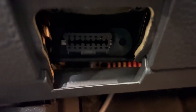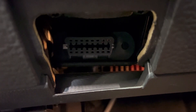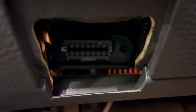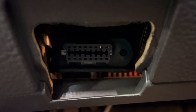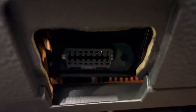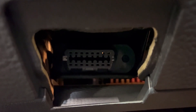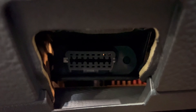As you can see, you don't need a breakout box to do this testing — it's the same idea, you just need to do a little research on what pins are what. If you count at the top from the left: one, two, three, four, five — that'll be pin 4 and 5. Then pin 6 for the CAN high, and pin 14 will be the CAN low, which is on the bottom second from the right. The bottom right corner is going to be the battery voltage. You can run all these tests directly from there.